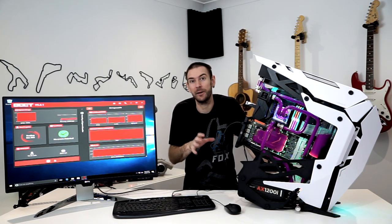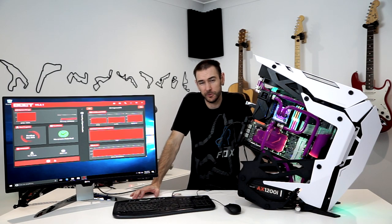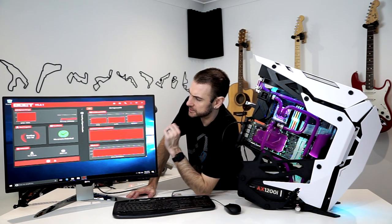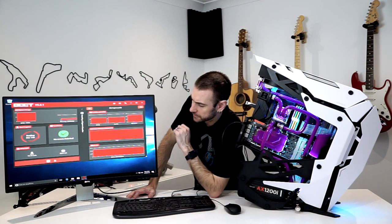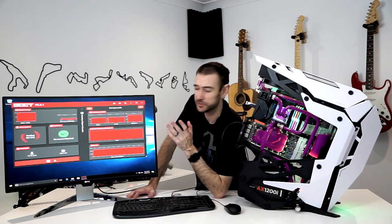Windows is all up and running. I had a few problems installing it — I kept getting the system lock up on the Windows loading screen. What I figured out was the automatic motherboard settings for the CPU were just not stable at all. It was running really low voltage, trying to run something like 4.6GHz at 1 volt flat, and as soon as there was any CPU load it just locked up immediately. I did a quick and dirty overclock to 4.8GHz on all cores at 1.3 volts, which I thought would be easily achievable. We've got OCCT running — no errors detected after 3 minutes, temperatures sitting at around 60 degrees on the CPU, which I'm happy with. That's at 4.8GHz at 1.27-1.28 volts with VDroop.